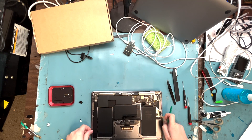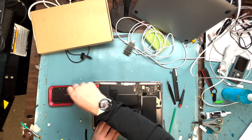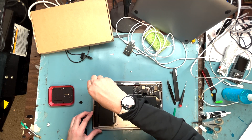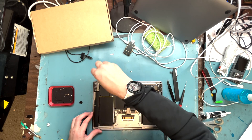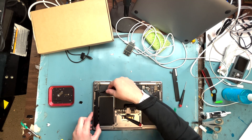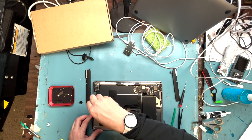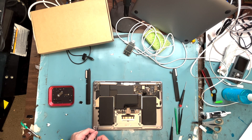This will make it a little easier — grab the T3 screwdriver and get that screw underneath the loudspeaker on the right side. Then use the T3 screwdriver on the top left and remove the bracket so we can disconnect the loudspeaker from the left side and move it up.